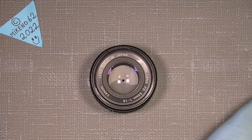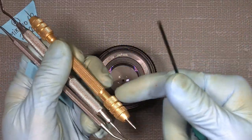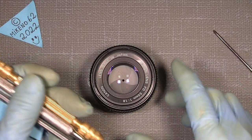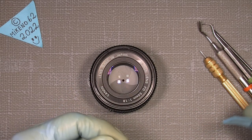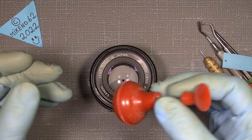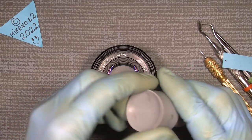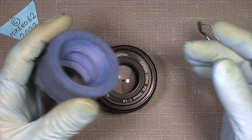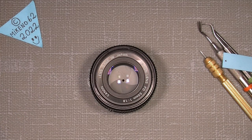Now, we need some tools, not very many. Some regular dentist tools, a pencil, I mean a pen, for scribing, and a JIS 2.5mm screwdriver. Yes, it's a Japanese lens, so you use JIS, not a Phillips screwdriver. They look alike, but are not the same. A small lens sucker from Japan Hobby Tool. No, I'm not sponsored by any company. And a rubber tool, and an old gasket from the plumbing section in the hardware store. Also a caliper to measure the distance. So now let's jump into it.